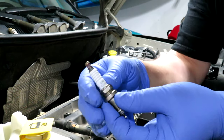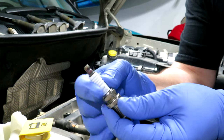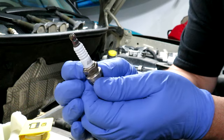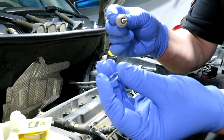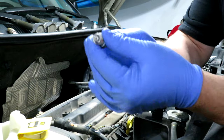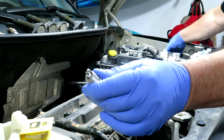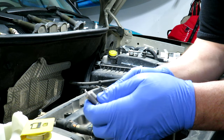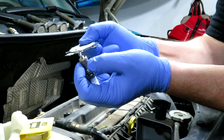For the reinstallation I like to try and keep the spark plug as clean as possible - it doesn't take much to create a miss by getting some dirt or debris on the top cap. The spark plugs I'm using are the Autolite APP5224 platinum brand - I'll put a link down below. The steel washer that goes on the base came separate, so I'm just going to thread that on. I'm surprised they don't come pre-installed. They usually come pre-gapped as well - my 2.4-liter says the spark plug should be gapped at 0.044 inches.